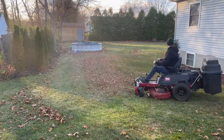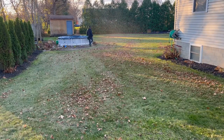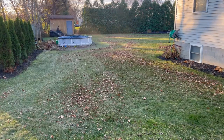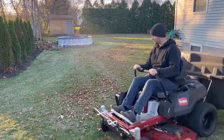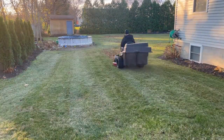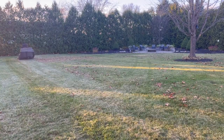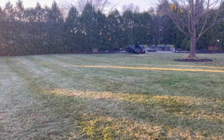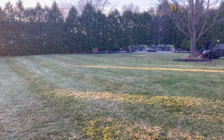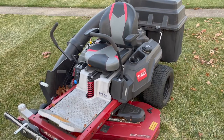To prepare your mower's fuel system for the winter, you have to understand that most gas that you get today at the pump has ethanol in it. This is completely fine in warmer temperatures, but when it gets colder, the ethanol in the gas can potentially clog the fine jets in the carburetor, which can make it very difficult to start in the winter or the first time when you go to use it in the spring. Now if you plan on continually using your mower with a snow blower or plow attachment, it may be a good idea to add a fuel stabilizer during the colder months to keep this from happening.